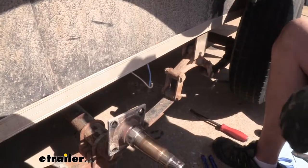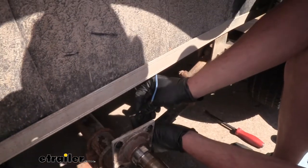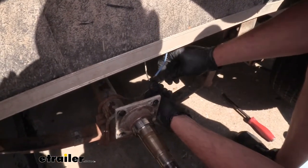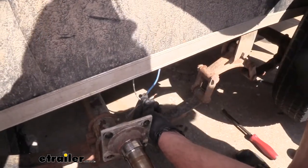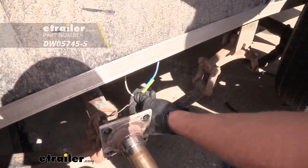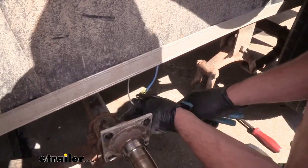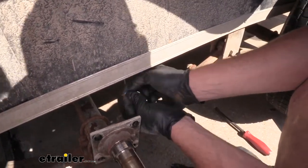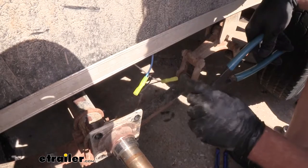So for our wires here, we need to strip them back. The white wire — generally that's going to be a ground — but since it is a magnet, we just need to put power through it so we can connect our wires either way we want. So I'm going to twist the two of those together. And to give us great corrosion resistance, we're going to use DW05745 — this will be a heat shrink butt connector on both of them. We'll get our wires twisted, get them pushed in there, and then crimp it down really well. Make sure we've got a good contact there and do the same thing with these. Now that's going to give us our spot to connect.